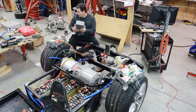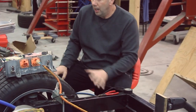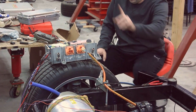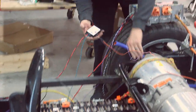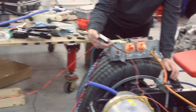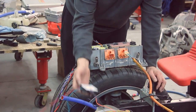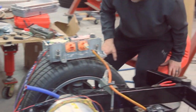But first things first, I want to get these chargers and make sure that they are working correctly. To do that, they have to be hooked up to a charging system, and they have to actually get a CAN bus signal. To do the CAN bus signal right now, I'm using this Thunderstruck Motorsports unit. What this really does is basically just trick the charger to turn on, since the CAN signal says, hey, please turn on now.